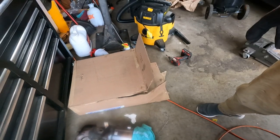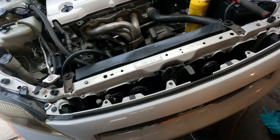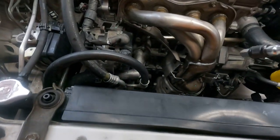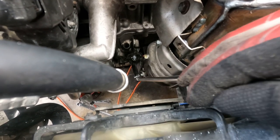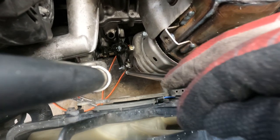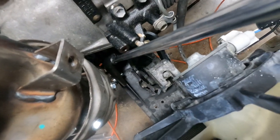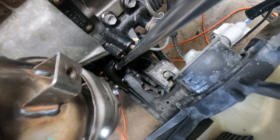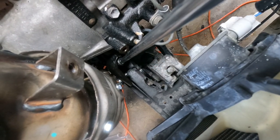That's it — just one heavy coat, that should be plenty. While that's drying I'm going to go under the car and bolt up the exhaust down there. The bracket is on with new hardware and a new stud on this side, tightened down. Before, it was only tightened here and not to the block, which is what I was hearing from the vibration. Same thing on this side — there's a bolt I put in here because I couldn't get a stud in, not enough room. I found a bolt in my hardware box and put new nuts on as well. Everything is torqued down and tightened.